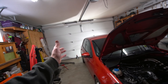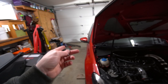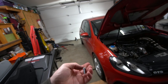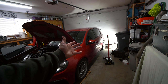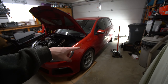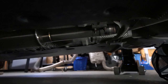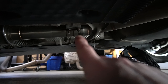You can reuse your stock hanger or buy a new one. Where the rear catback or the muffler and the resonator meet the midpipe, you have two hangers there - again, reuse or buy new. So if you're going all new hardware, you're going to need four total hangers, along with the stock GTI passenger side hanger. If you're buying an exhaust off someone parting out a vehicle, try to get the passenger side hanger. For bolts on the rear hanger or heat shield, these are M8 by 1.25 or 1.0 thread pitch, 20mm long bolts. You'll also need an exhaust clamp to connect the midpipe to the muffler.